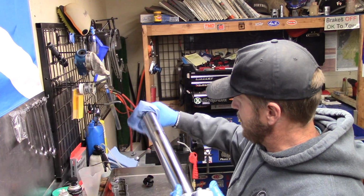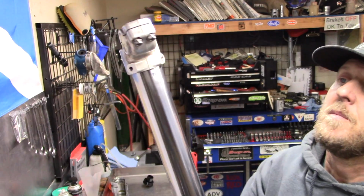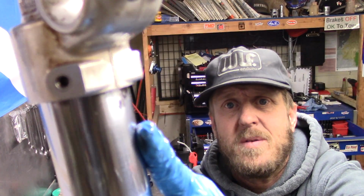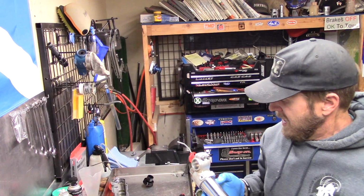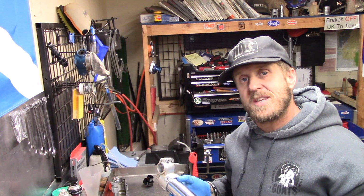And see, this gentleman, I already saw this before, but he's got some pitting right there. You can kind of see, I don't know if you can see that. Anyway, yeah, you can see. Anyway, so what we're going to do is we're going to smooth that up. And I've already tried cleaning it like the normal way with some Scotch-Brite, and it's not really working. So what we're going to have to do is get some emery cloth.